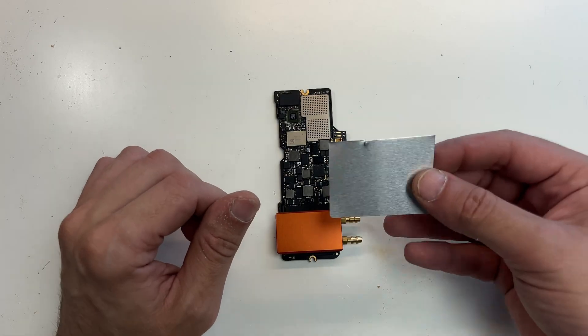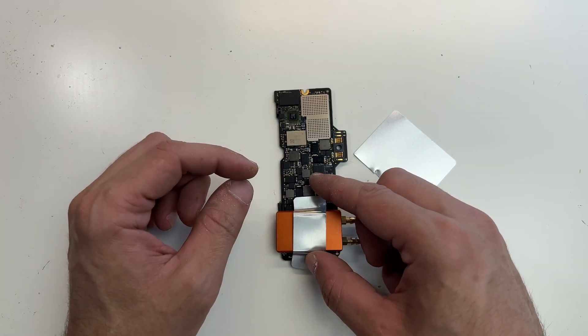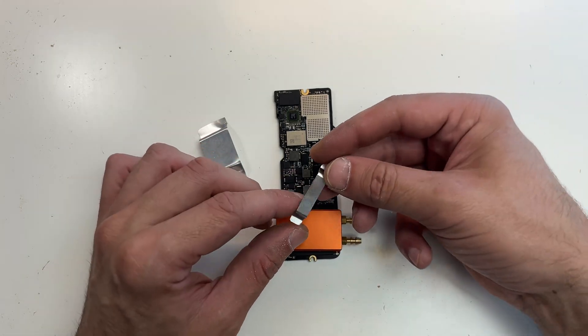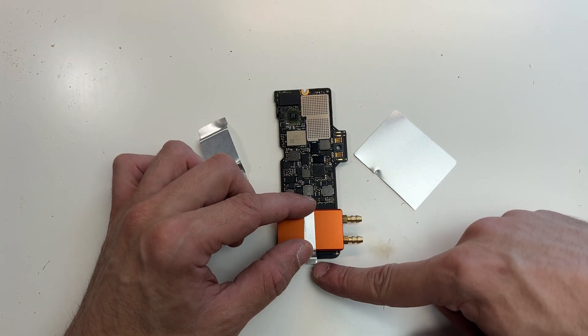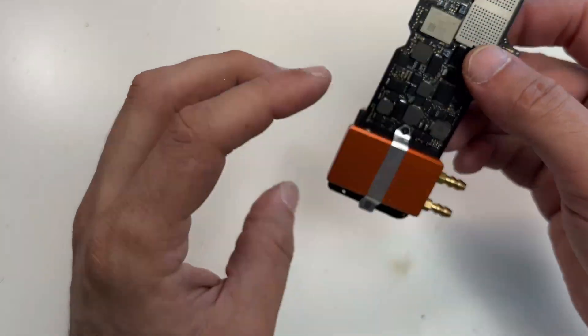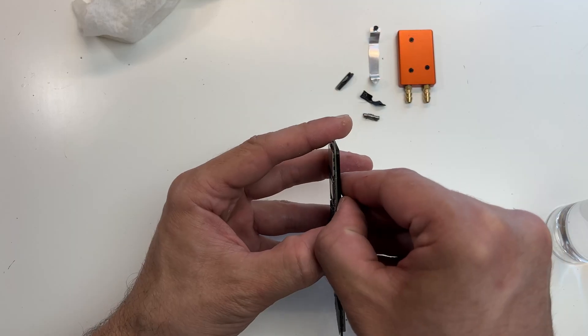I need to keep the cooler pressed against the heatsink of the Mac and I had to DIY this. I took some thin metal sheets, cut out the form I needed, and bent it to match the cooler and heatsink. I'll use one of the screws that is holding the heatsink and the other will be on the other side of the board — perfect.